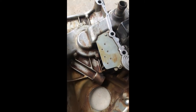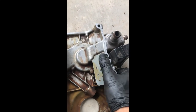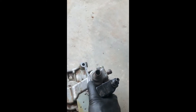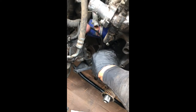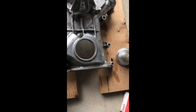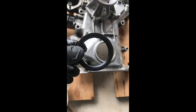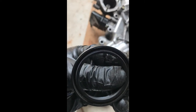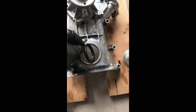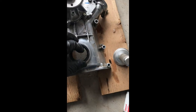This by the way is the PCV valve — to check if it's working, just shake it. If you can hear it making noise, it's working. If there's no noise, this might be your chance to change it. Next I'm going to remove these two washer gaskets. The water pump is in. Next will be the seal — it goes in this direction, with the groove to the inside. There's a spring inside. Put some oil around the edges and push it in.